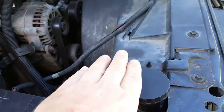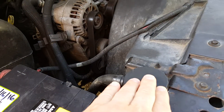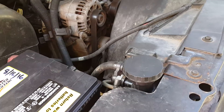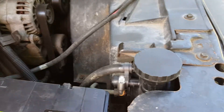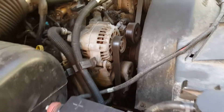You never really want to check under this cap if the car is hot. You want to wait a long time, because if you open that up while your car is hot and you're pulled over on the road, it can just spit out in your face — that's really dangerous. So if you're ever low on coolant, don't check it while the car is hot. Check it when the car has been sitting for quite some time.